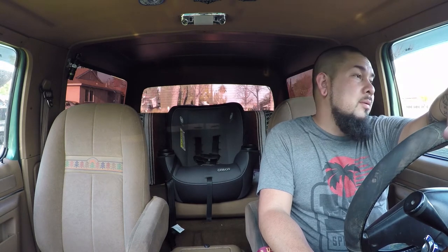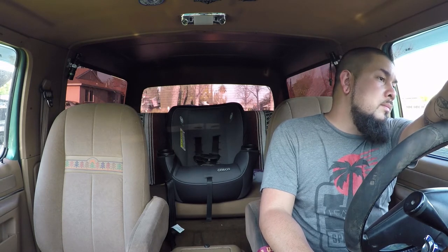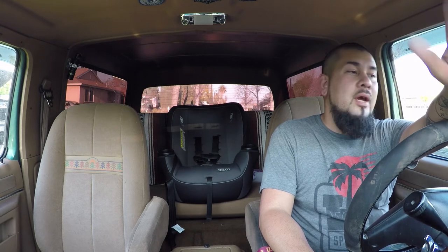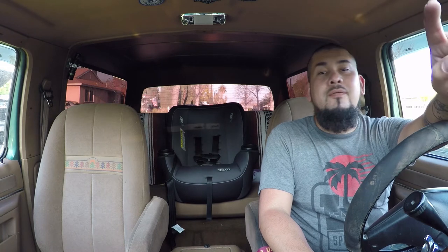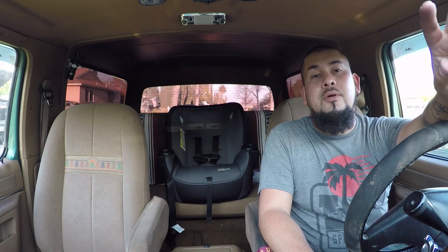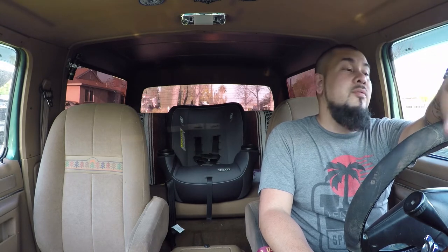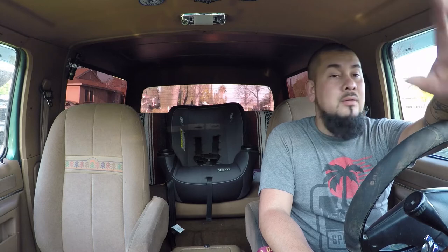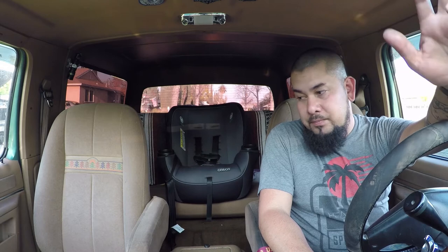I didn't think it was gonna be a cool video or whatever, but it's an easy install. Three wires: ground, hot, and then your green wire to the actual sensor. I mean, it's reading accurately. I just gotta figure out if the Teflon is gonna end up messing anything up, or if I should remove it. But for now, I'm gonna run it with the Teflon, see how it goes. If it gives me inaccurate readings, then I'll take it off and just run it without it. I just wanted to make sure it didn't leak. But yeah, it was an easy install.